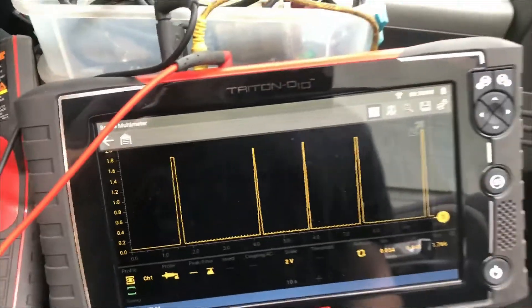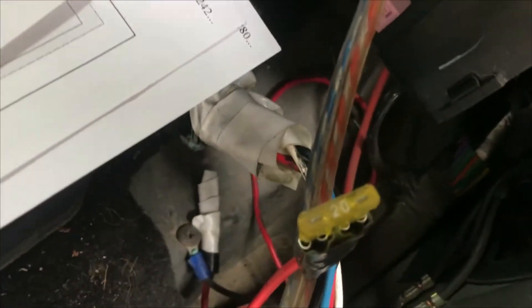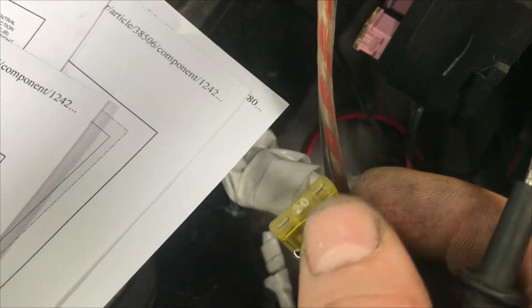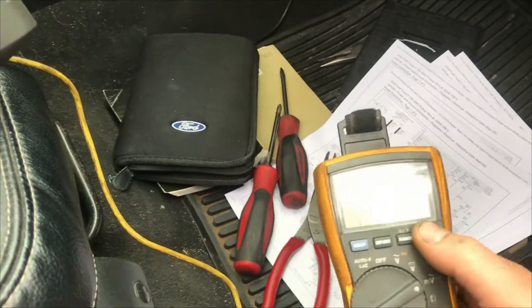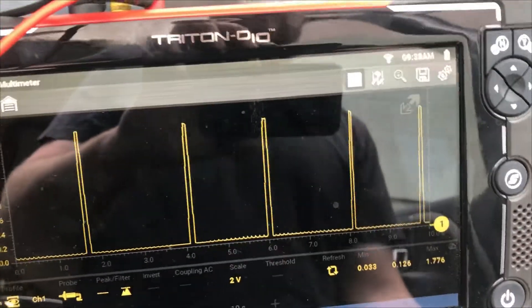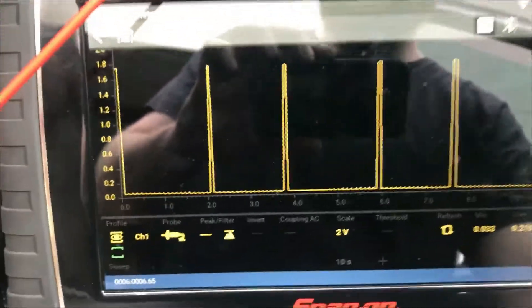What we can do is take a multimeter — in this case a graphing meter, it'd be hard to do it otherwise — and put both leads on either side of a fuse. You'll see a voltage drop difference between the two terminals if there's current flowing through. You could use a multimeter on the millivolt scale since it won't be a huge difference, but you'd have to stay on the fuse for 30 seconds or so to make sure you catch it.